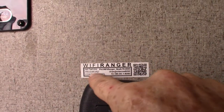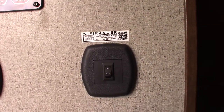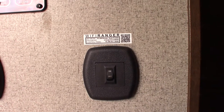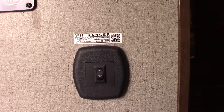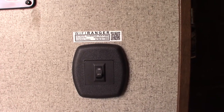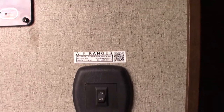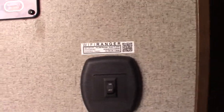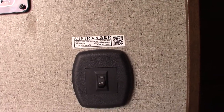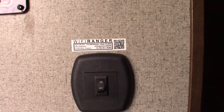The middle is the temporary password — 'Change Me Now' — 8095, so you're going to set your own password using that. It's the option people use the most — it's the free option to get better public WiFi. There is also an option to use a SIM card — you'd have to go through your cellular service provider; it would be like paying for another phone or a tablet with a monthly fee. You can use this for cellular too, but most people don't because they've got their phones anyway. That's a paid service. The most common use is the free public WiFi booster.